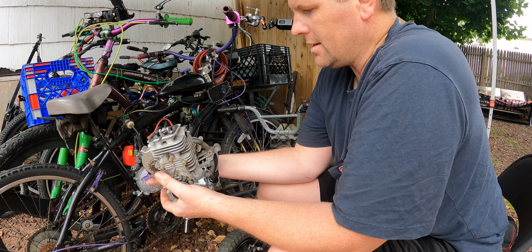The transfers now, it's one of the injection molds with the nice transfers. I really didn't want to do anything to it, but I really needed to get the transfers up a smidgen, and I didn't want to ramp the piston. So I had to go in and ruin the transfers on this. But they now open at 124, closed at 236. We now have 112 degrees of duration. So that was nice. I was able to raise it just a wee bit.